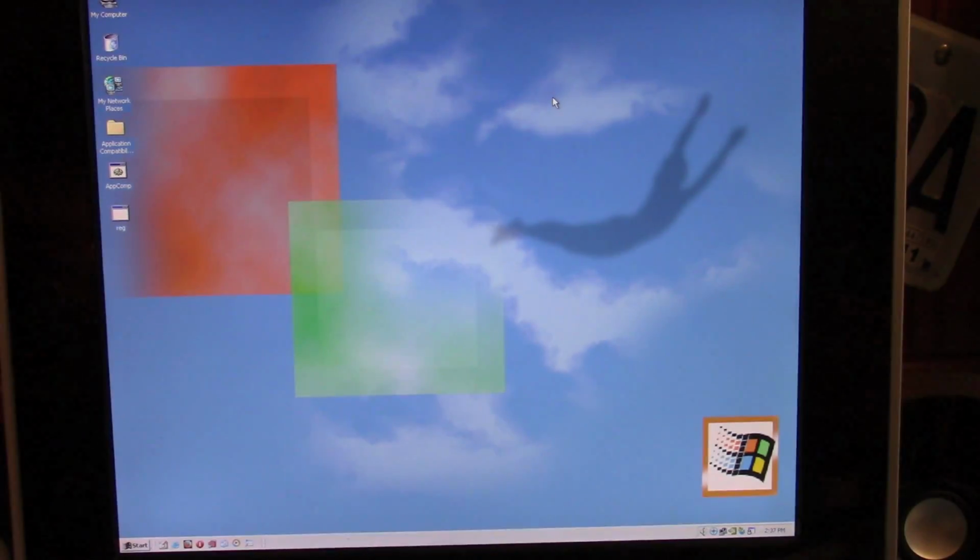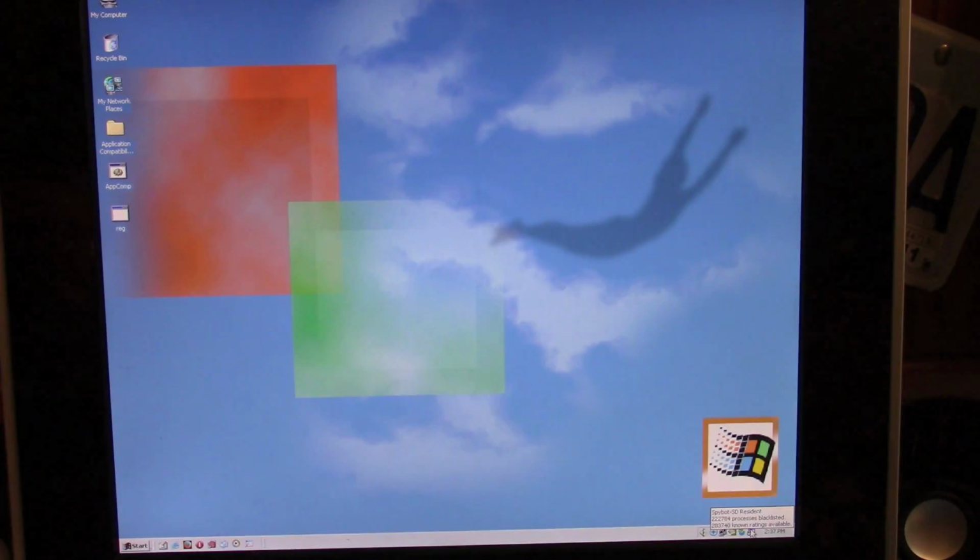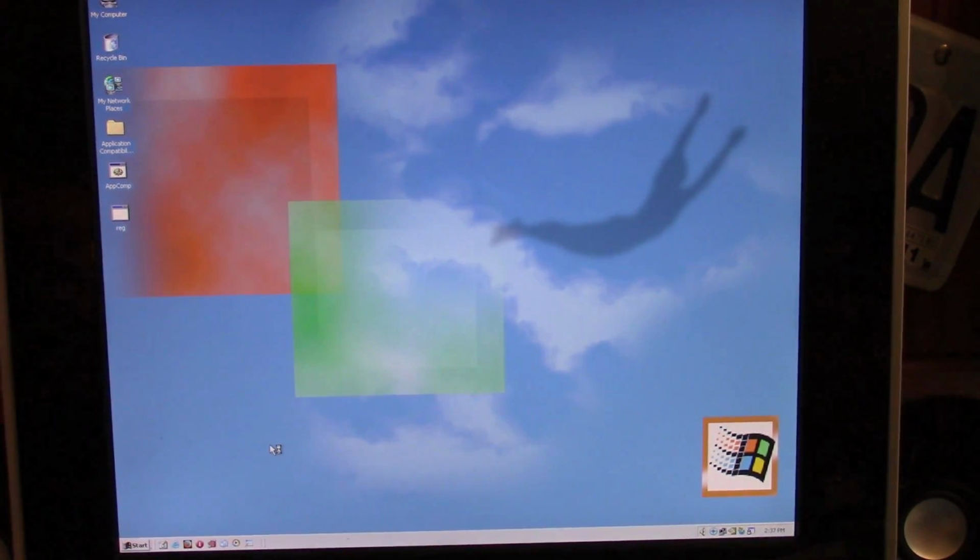Well, your next thought for testing might be web browsing, and that's certainly a possibility. For defense, we have Spybot Search and Destroy and ClamWin Antivirus. They are very functional on older machines. In particular, Spybot 1.6.2 still receives updates and works on Windows 98 natively, and 2000, of course, natively. ClamWin is open source and designed to be compatible with almost all versions of Windows, it seems, that I've tried it on. It's not an active antivirus, but it does give you at least a scanner.